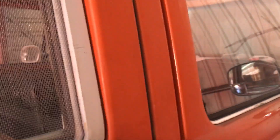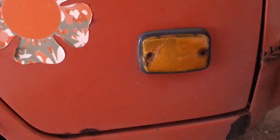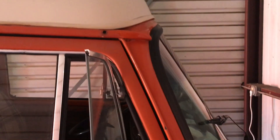The door doesn't quite fit right — the line on the door is not quite right, and the bottom edge of the door is a problem. There's a cracked side marker lens and more rust down at this corner. There are signs of repair here because I think this bus was in a front end accident. I think this post right here is not quite where it's supposed to be, and that's causing the door to be slightly off.